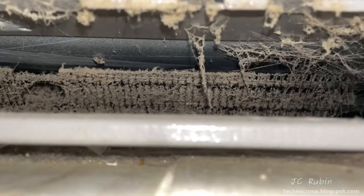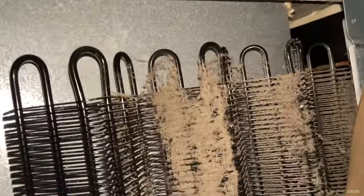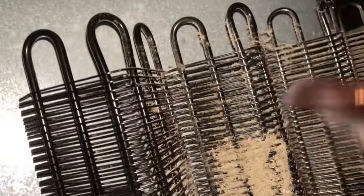It'll look something like what you'd see on the bottom of a refrigerator ready for cleaning. And it's not going to be one layer of fins — it's going to be wrapped in an S-shape, several layers deep, impacted with lint and very difficult to clean for the average consumer. On a heat pump, those fins are much finer, harder to access, and more tightly wound.